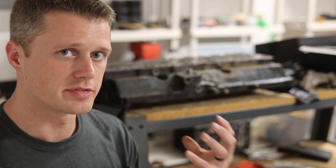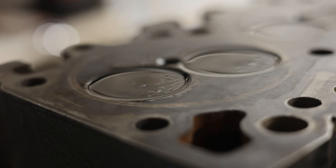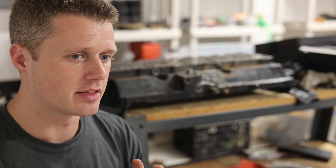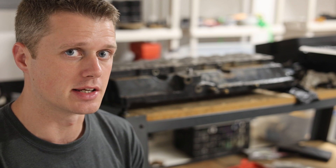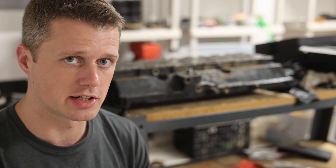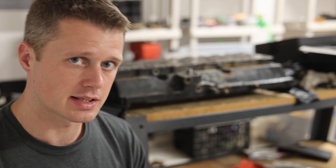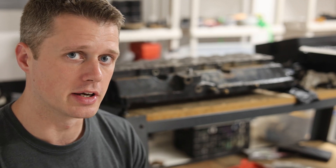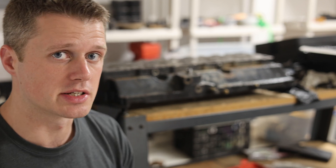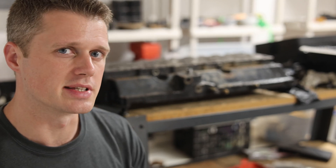What we've done is put oil in all of the valve surface areas on top of the head and let it sit overnight — we don't have any leakage, so that's good. Now we're going to send the head off to be decked and they're probably going to grimace when they see the cracks. I'll tell them it doesn't need to be magnet dusted — I've already checked the head and we know there are a few cracks in the injector port. So we're just going to send this off to get decked, pay a couple hundred bucks, slap it on with the head gasket and call it a day. This build is going in my personal 80 Series, so if it does blow up I don't feel bad about it — we'll just rip it out and put a new one in. We're going to continue with assembly.